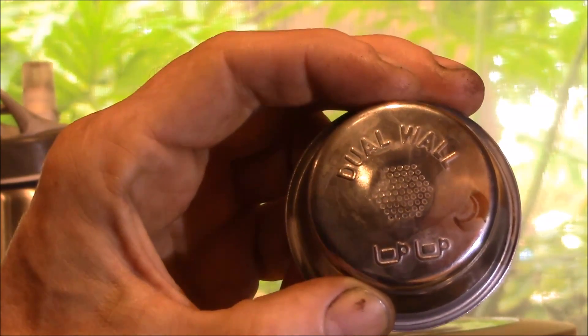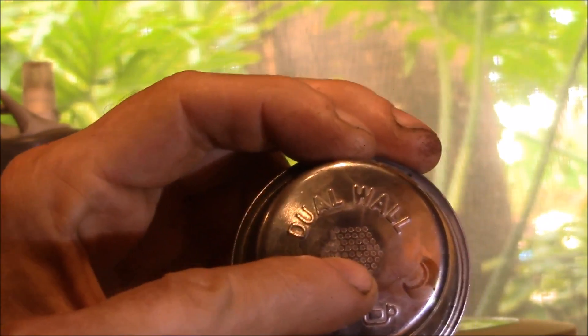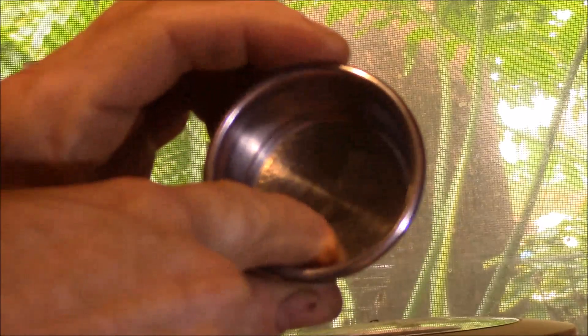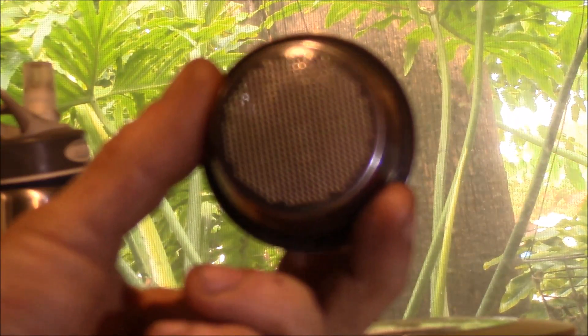There's usually only one or two actual holes — they call it a dual wall filter. What that does is those small holes are what creates your pressure drop when you're brewing espresso. You've got your 15-bar pressure on this side of the filter, and one bar atmospheric pressure on the other side. All the pressure drop occurs between the two layers of this filter — all these holes here are open, but there's only one or two little holes in the bottom that are open.